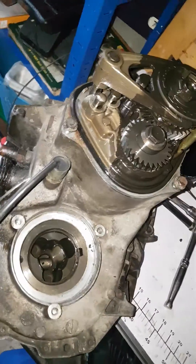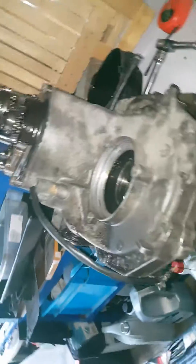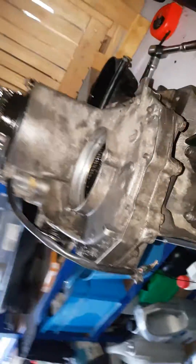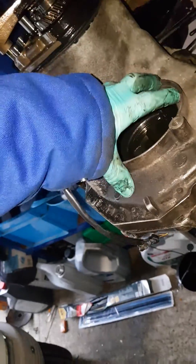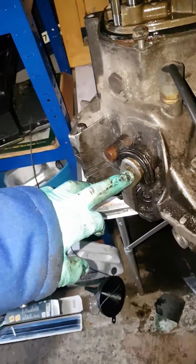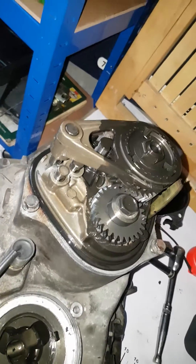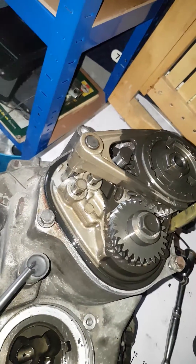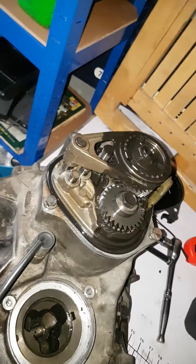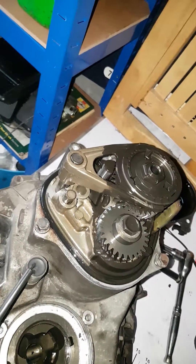So this is my gearbox. Obviously it's in a bit of a different position — in the car it would be up like that, so you'd have the passenger side driveshaft coming out this way, and then the driver side one would go on to where this roll pin here is, slot on the roll pin and go through. That's your differential there. On this one, this is your selector fork that goes inside here and moves up and down accordingly. I've been able to figure out where it would be by simply finding fifth gear, which is this top one here — pulling all the way out, which would be rocking the gear lever over to the right like that. You select fifth like so, which means that in the middle we're going to have third gear and over to that side we're going to have first.